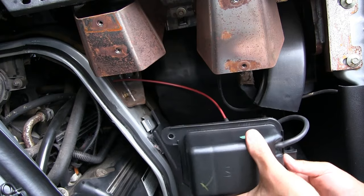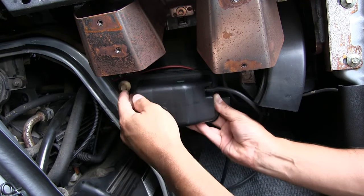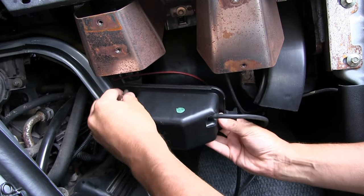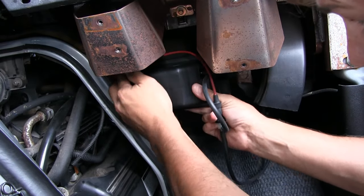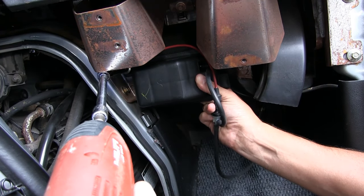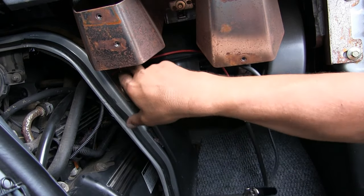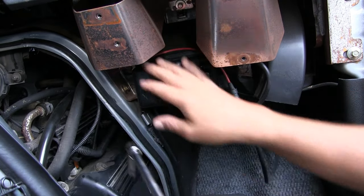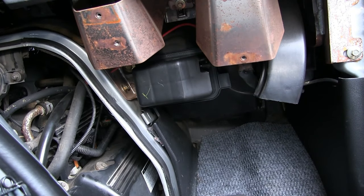Make sure it gets on all the way. Then we're going to utilize one of the bolts for the bracket on the dashboard here — we're going to run through the side of the accumulator and relocate it here; everything will still go back together. We're just bypassing the one inside the heater box and putting it outside the heater box. Make sure not to pinch that vacuum line. Take the 10mm and run that in — the bracket's still in place with one bolt. The upper bolt's removed so we can run the vacuum line through. Snug it up, but don't snug it too tight or you could crack the plastic. Then tuck all this up nice and neat into the dashboard and put the plate back on.